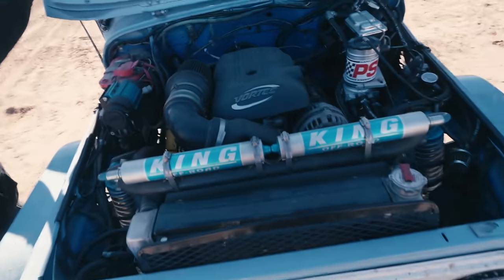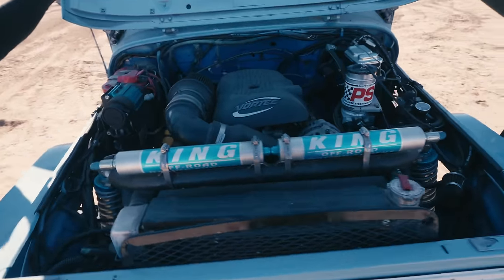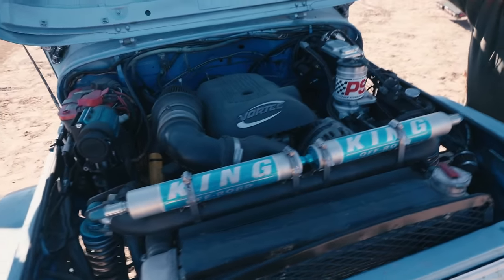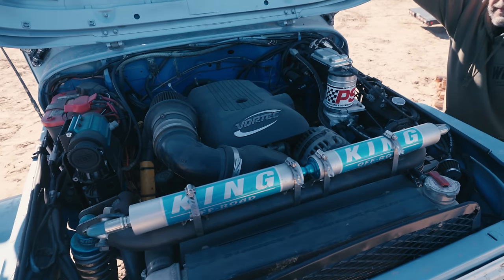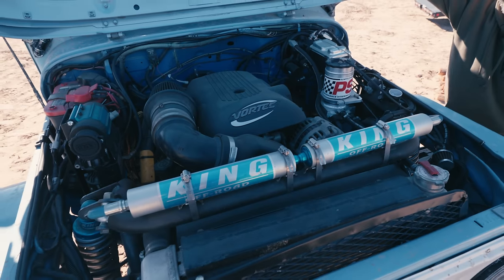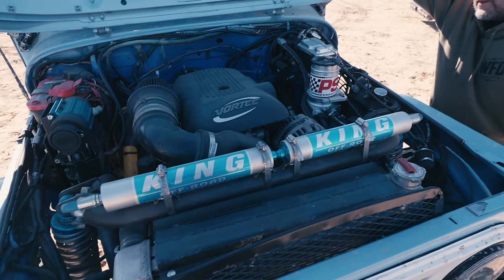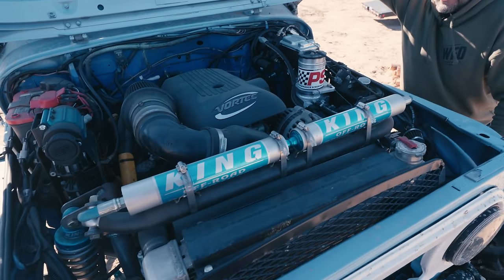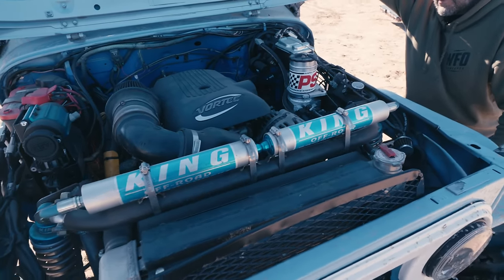That's a 5.3 LM7. I got a Brian Tooley cam in it. Brian Tooley LM7 or LS7 injectors and valve springs. I did the Truck Norris cam in it, and then just tried to wake it up a little bit. And you're still running the GM operating system, factory computer? Yep, I did all the HP Tuners through it.